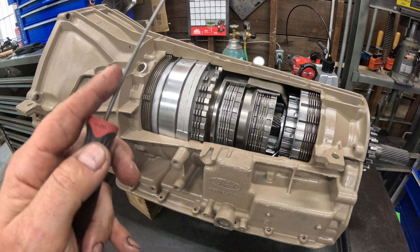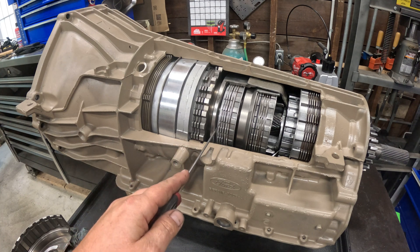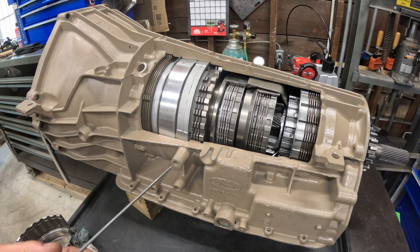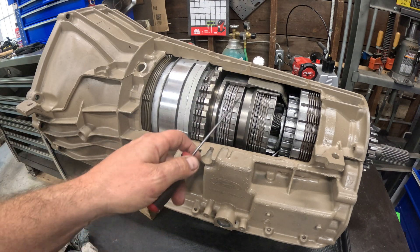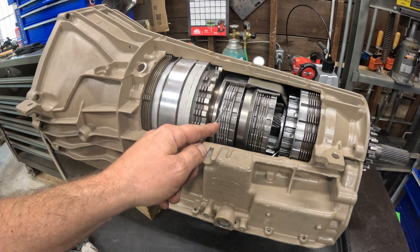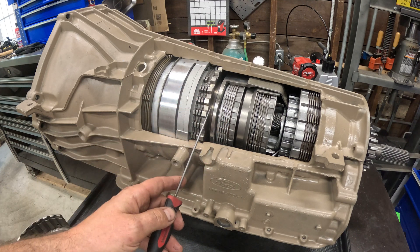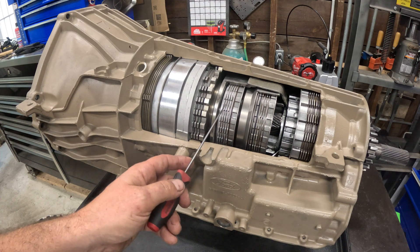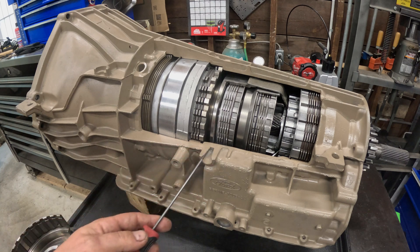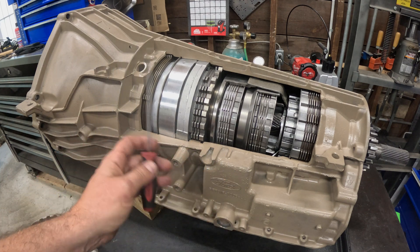I actually have a lot of these — more good ones than broken ones as far as that diode goes. I figured I need to do something with these things, I have tons of them. This one was actually a gasoline one that came out of a diesel truck that I tore down once. So somebody somewhere down the line not only swapped in a diode style drum, but they swapped in a gas one. I just recut that so I could get the diesel clutch count in there. Not that that really matters, but these are all stock clutch counts.